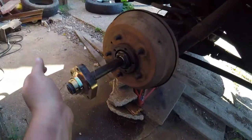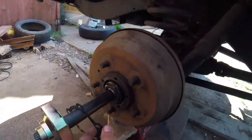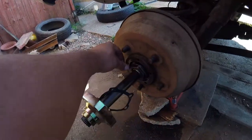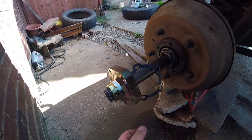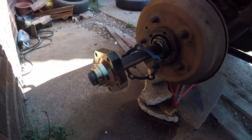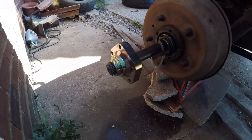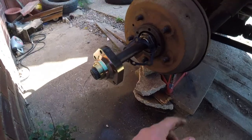The Salisbury one is on, the rear axle is on. Remember to do this gasket first — same again, I've put a little bit of oil on there to help it stick, and if I need to ever get this off there's a good chance it won't be stuck to the hub. That old school mechanic trick I was taught. I had trouble getting this on — I did originally think it was the wrong one because I could not get it on, but using a rubber mallet, as you can see, it's now on. Put the circlip on, Loctite on the bolts, and then this corner will be done.